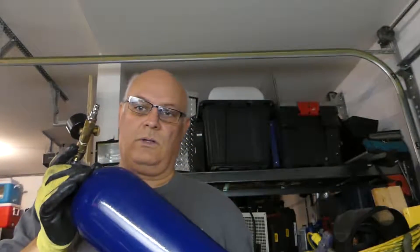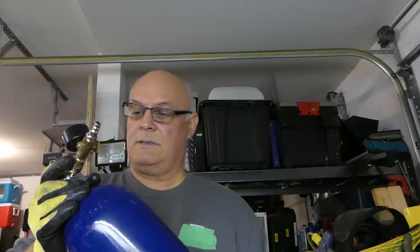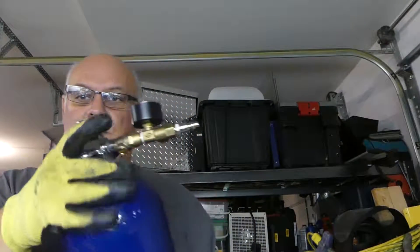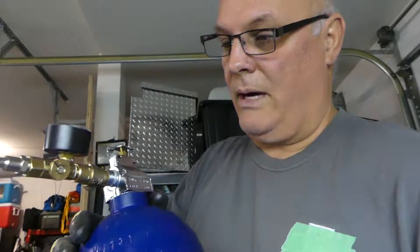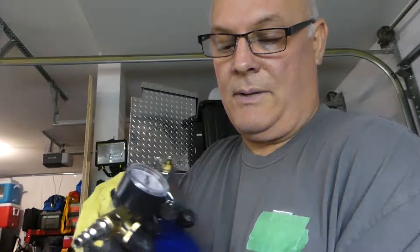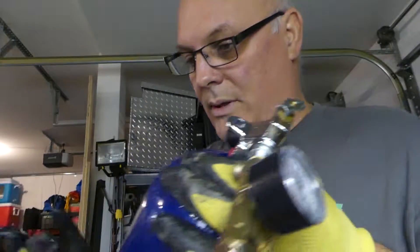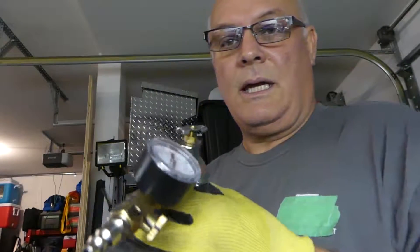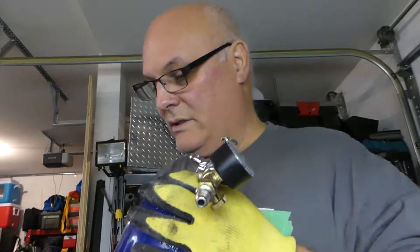We made this ourselves. We just took an old CO2 fire extinguisher that had the front top of it damaged, so we took it all apart — you can see it in our projects video. We put in an air line, we modified the top, we drilled and cut and threaded it. We put in a pressure reducing valve so we could have just the right amount of pressure. We've got it pre-marked so that we're going to pump 40 pounds of air pressure into this thing, so we can make sure we're not blowing seals on our brand new motor.